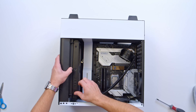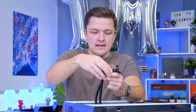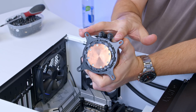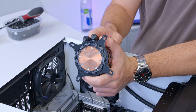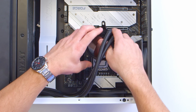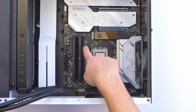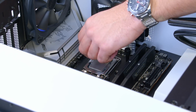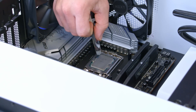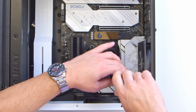Once the fans are screwed in, screw the whole sled back in and finish with the water block. Pull back the bracket we talked about earlier and attach it to the cooler, making sure the two endpoints are equidistant from the tubes in the middle so the whole thing is symmetrical. Remove the four thumb screws added earlier and use those to secure the cooler down. A dab of thermal paste to make that thermal bond between the CPU and the cooler as strong as needed, and that's basically it for the CPU cooler.